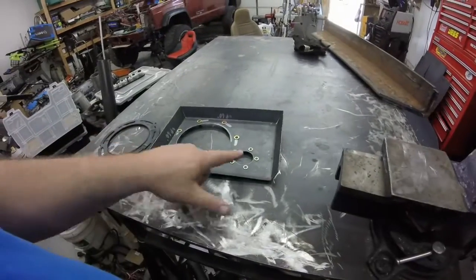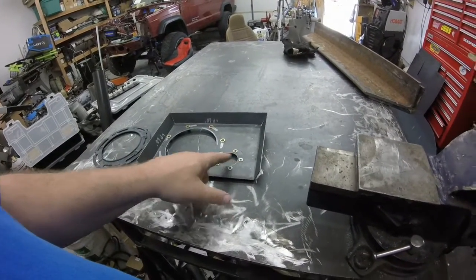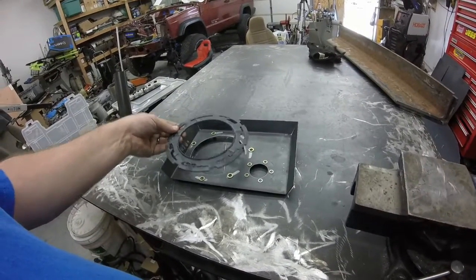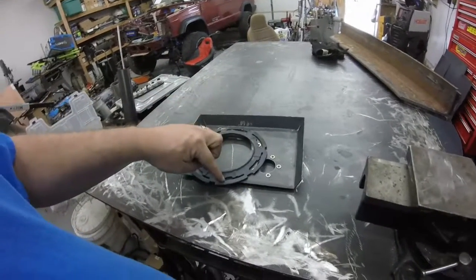There's going to be some random clips in this episode showing me bending sheets for the fuel tank. Here's part of the fuel tank — I've got this for my fuel pickup, which in retrospect I should have mounted a little further over; it's a little close to the ring. The stock fuel pump goes in there and I'm using the stock fuel pump ring. I just need to trim it in a few places and then do quarter-20 bolts through these slots with a thick rubber gasket underneath to hold it in. I'll probably put some RTV around the rivet nuts so it doesn't leak. Anyway, thanks for subscribing — I'm almost at 90 subscribers. Appreciate it, see you in the next one.